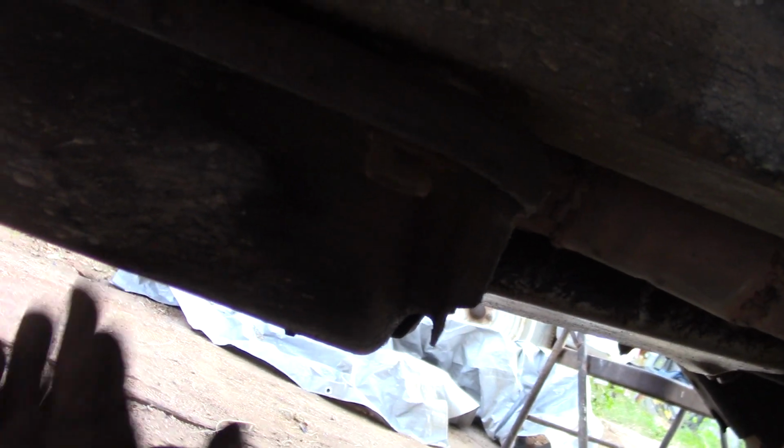One solid piece, front to back. And even though the welds are ugly, I know they are leaking in some spots. Like right here, I can see evidence. Over here, but if I clean these up, I have a different muffler that I can put on it. That one doesn't look horribly beat. I'm just wondering if I should just drop this skid plate, jack up the transmission, make sure that it stays where it is, remove the whole exhaust system and decide what I want to replace.